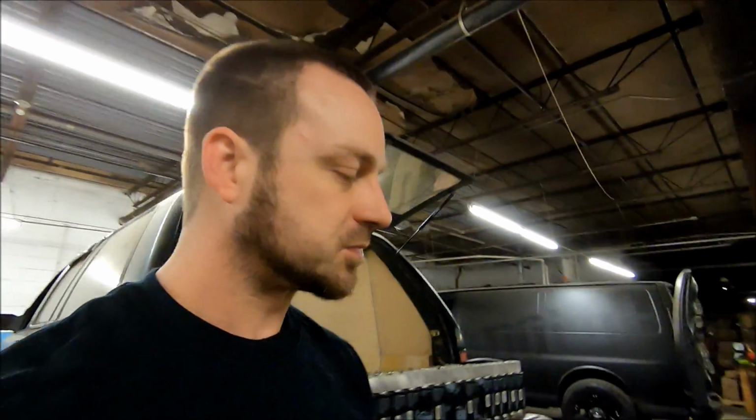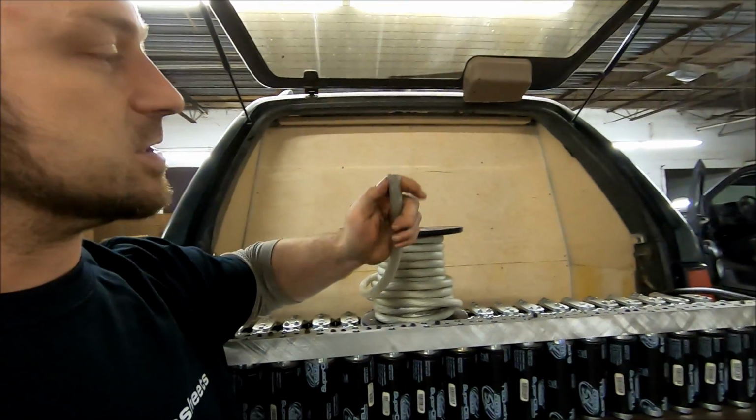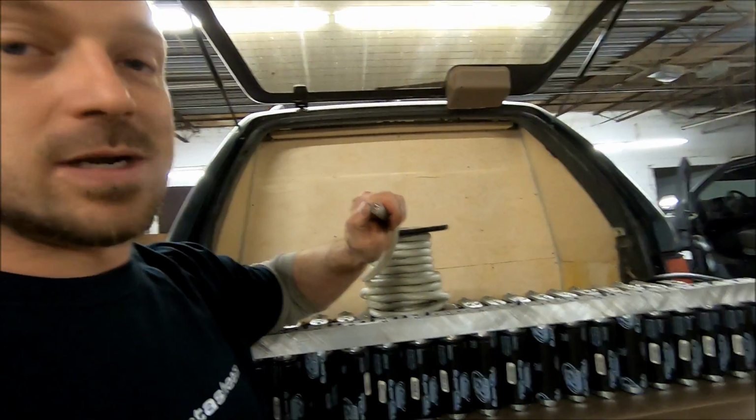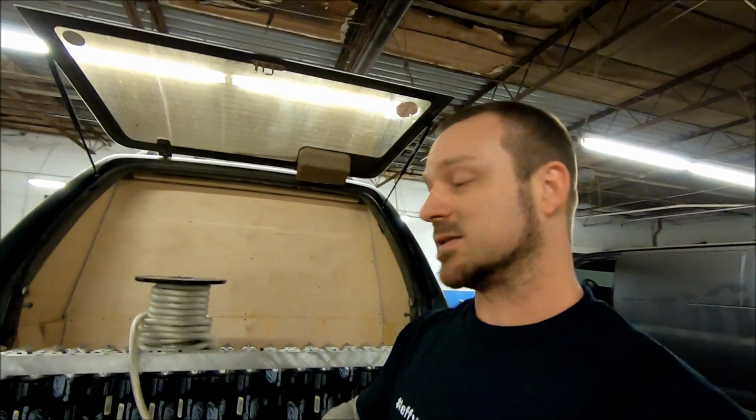Also keep in mind, not all wire is created equal. There are some really bootleg wires out there. I'm talking just some garbage, junk, generic wire from China that you've seen. If you haven't seen it, look it up. You can get some wire that's going to claim it's 1/0 wire. It's going to be huge. And I'll grab some of our 1/0 to show you right here. So you're going to get some just generic junk wire. You're going to look at it and you're going to be like, oh man, that wire's huge. But as soon as you cut it and you look at this side of it, you're going to see a huge jacket with very little wire inside. So pay close attention to the brand of wire you buy. It is not all created equal. There are wires that are better than others.